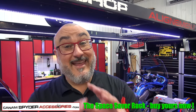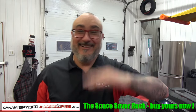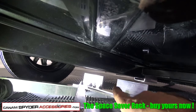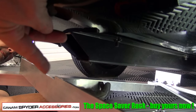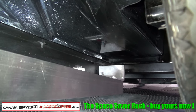The only thing left to do is make everything tight and install the wheels. Now we're going to give you a couple of tricks on how to insert that Space Saver Rack underneath your trailer so you can stand her up. Steve came up with a good point — don't forget, when you're putting that Space Saver Rack underneath your trailer, you've got to make sure that you have the room to stand it up. It is a tight fit, so you're going to have to lay on the ground to slide it in. You've got the opening right there, so that's going to go right on the frame. You're going to slide it forward — it's like a guide to enter right in the hole. You also have an opening right here that's going to guide you once you slide it forward. There's a small bolt that's in the way — you're going to have to slide underneath it. The small tongue in the opening — that's in.